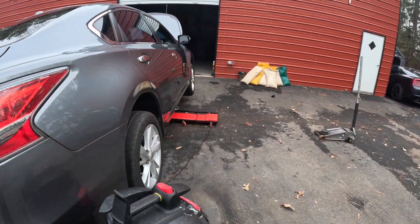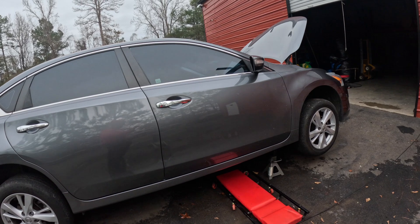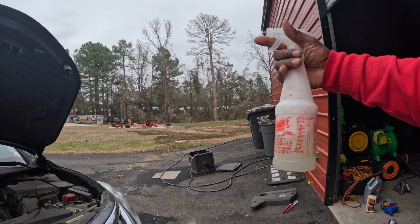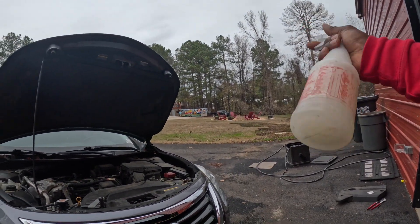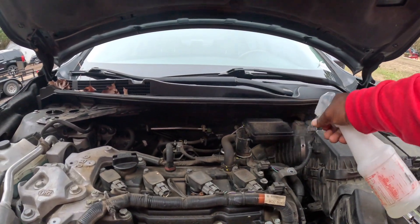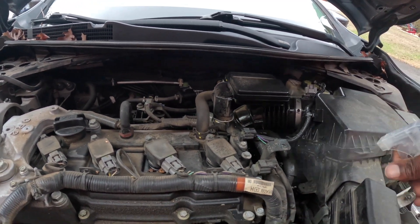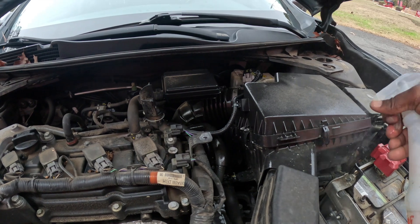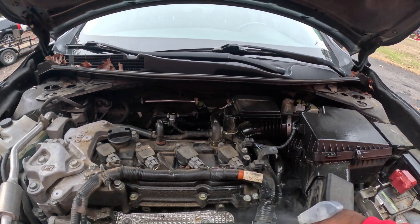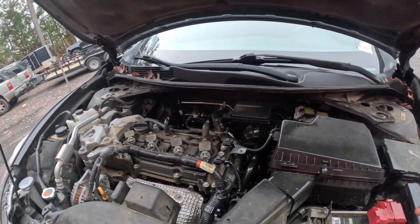You kind of need a strong wet/dry vac for this. Put the wet/dry vac on — it's pushing air in. You also need a solution of just soap and water. What you want to do is spray all around in here. It'll start bubbling if a leak is determined somewhere. We're gonna go up under the car too because I'm thinking this is where the leak is coming from, all around the manifold.